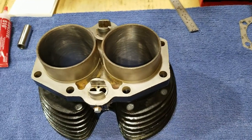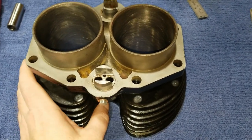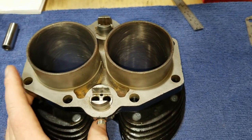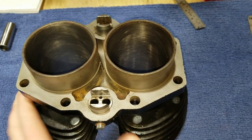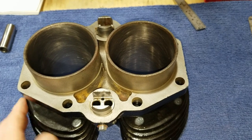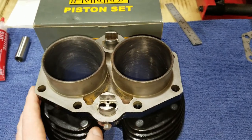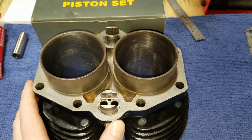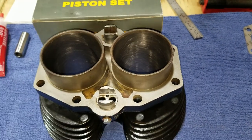All right, so we're kind of at a standstill here. This is the previous footage you saw, where we came up with the conclusion that maybe the pistons are a little bit tight with the cylinder bores here, right? So what we did was we took the tappets out. We're going to take this in and have the guy that machined and bored these just double check on the piston numbers and sizes. So anyway, that's what we'll be doing going forward here. And then we'll come back when we get our conclusion and we'll finish this up, but otherwise stay tuned. Let's see what happens here.